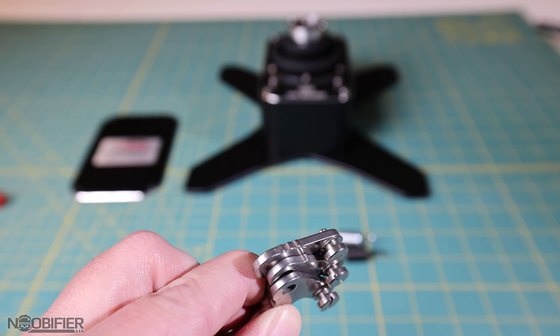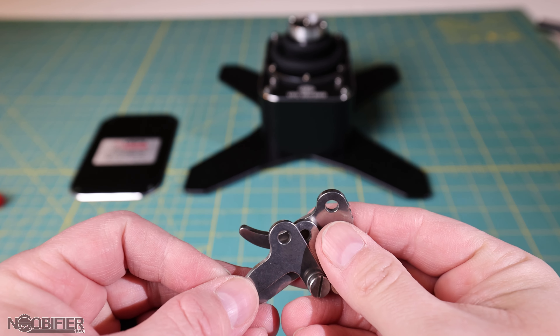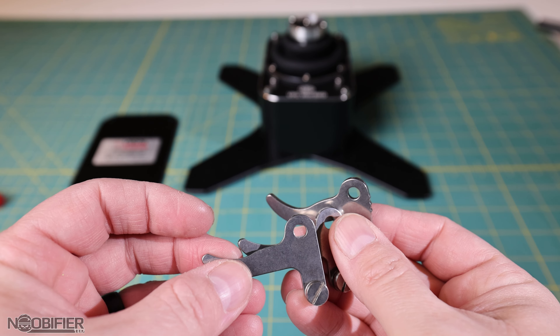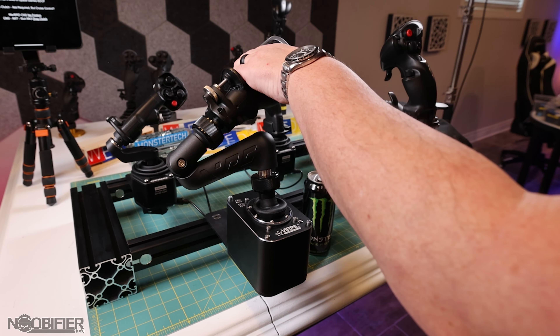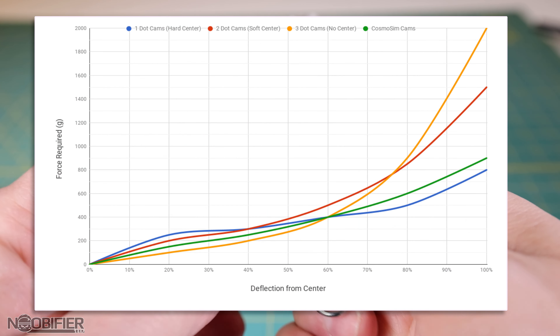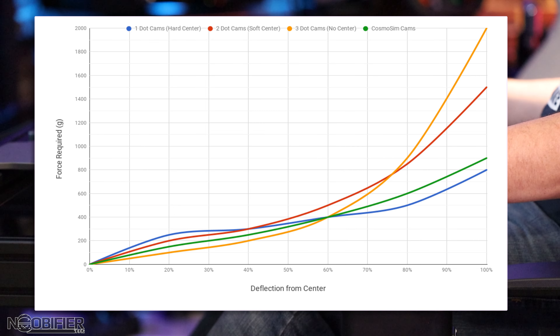Warbird includes a set of four cam profiles, which can be identified by a series of bumps but also by looking at the curve to get a sense of how they'll behave. Never mix your pairs of cams — two of the same type per axis. You can test one type in X and another in Y, just ensure the pairs are the same. By default you have a standard spring and Avia soft center installed. Avia-style cams have a progressive curve requiring more force as you get further into deflection — that familiar torque profile flight sim pilots expect. Cosmo or space cams have a flatter profile with constant force throughout the range.